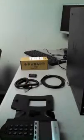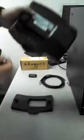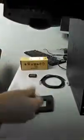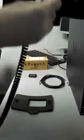I'm going to show you how to set up the IP450, the larger of the two phones. So this is the phone here. We have our handset cord, the curly one. That will plug into the handset cord port labeled here — there's a little picture of a handset. All these are keyed, so make sure you put them in the right direction and it should snap into place.